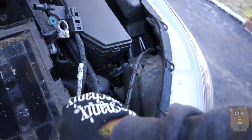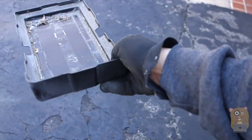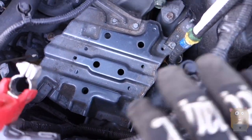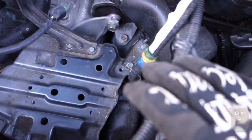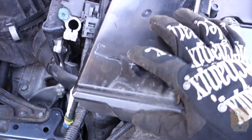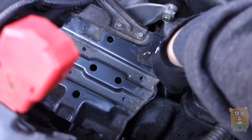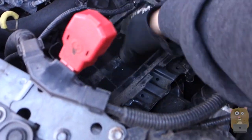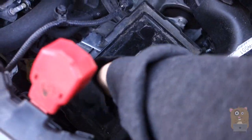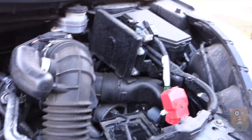The car battery sits on a tray and it's easy to remove the tray — there's really nothing to it. Just dump out whatever garbage is in here. Here's what it looks like with everything removed. It's a good time to check for any debris or any leaves — just take them out. Now when you place the tray back into this cavity, keep in mind that on the bottom of the tray there are two dimples that align perfectly with the holes on the bottom. You'll hear it just drop in place — now it's not shifting or moving anymore.